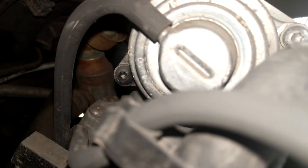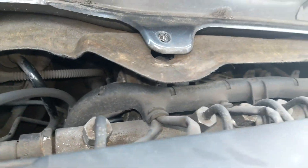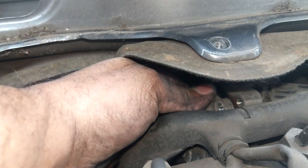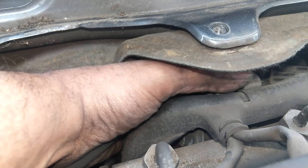So here's the valve here, and it's got the two bolts — reasonably accessible. On this particular one it was T30, two T30 bolts, and then just removing the vacuum pipe which delivers vacuum to the actuator, so the valve can open when it's working properly. With the bolts removed, it just needed a little bit of levering to get into the gap where the EGR actuator joins the rest of the engine. And after a bit of levering — that's held in by quite a bit of soot as well — I managed to get my hand in to remove the valve.